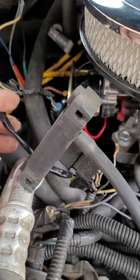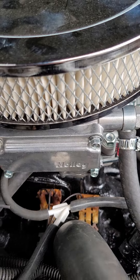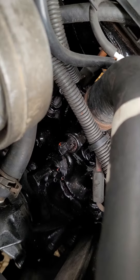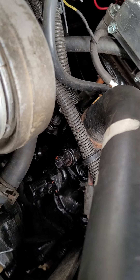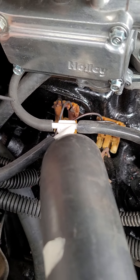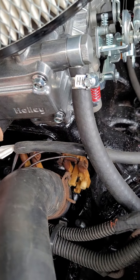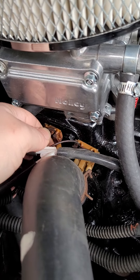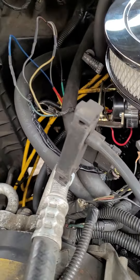You're going to need your MAT sensor hooked up. I wired it back in. Also didn't wire the ground wire that goes to your engine coolant sensor — that one is a one-wire but we need two wires, so we need another pigtail and wire it in. These other three wires are for your EVAP solenoid — don't need them, just tape those up. I'm going to tape up the throttle body fuel injector wires too so they're not doing anything.